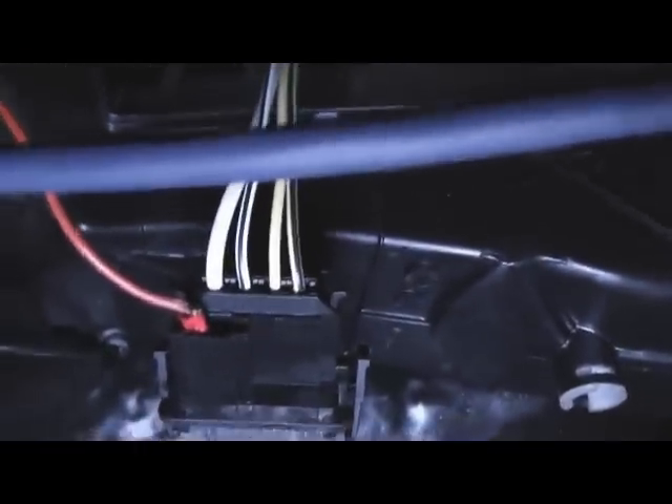And when you've got it, get it yourself. It's a bit tight. All I've done is I've put a spade end connector on it — instead of putting that connecting block in, that red wire, I've just crimped it onto a little spade end connector, I think it's about four and a half mil. Shoved it on the connection block, and then popped it back in there, back in its hole, nice and tidy.